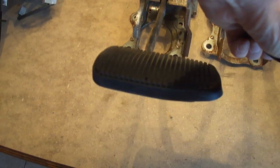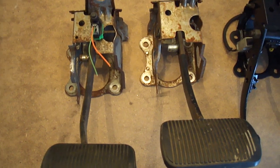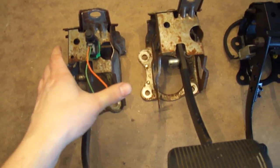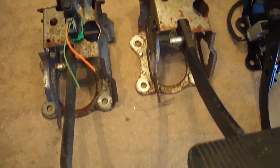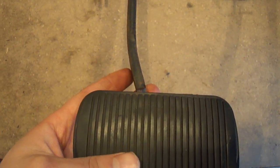Let's start with your Crown Vic brake pedal. From 92 all the way to 2004, they're pretty much the same, except that starting in 2005, Ford started to use electric adjustable pedals, so the housing is not exactly the same, but the procedure should remain basically the same. The main difference here is the pedal itself — this one is from a 97, it's straight; this one is out of a 04, so that's why it has an angle like that.